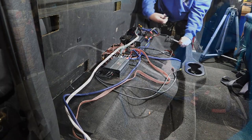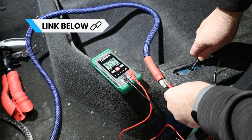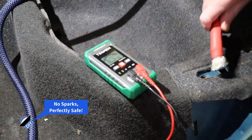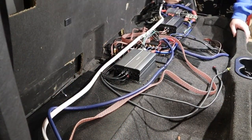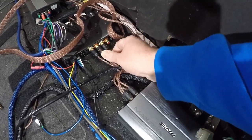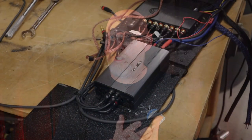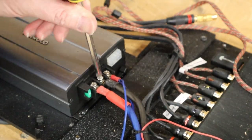I disconnected the main power line from the battery. If you need to verify you have no juice back here, grab a multimeter. Here's an inexpensive one — this is a Tessman, you can get it on Amazon. What I like about it is that even though it's not a full-featured multimeter, it's kind of idiot-proof in that it's auto-selecting between AC voltage, DC voltage, or continuity. It's also got a little flashlight and can work as a non-contact voltage tester. To get the amp rack out of the car I have to unhook the amplifier speaker cables and the RCAs, then remove the power wire and ground wire. The amp rack is now out and on the workbench for easy disassembly. Everything here is either going into storage for a future project or getting reused on the rebuild.